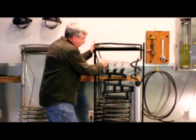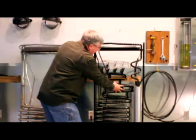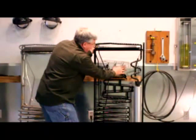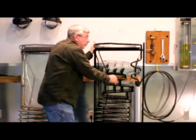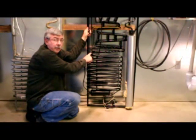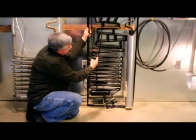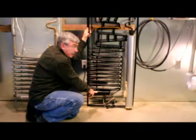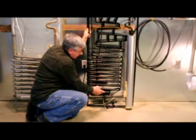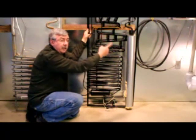The ammonia vapor slowly passes through the evaporator — from the low temp evaporator down to the high temp evaporator, and down to the exit of the evaporator line. This is where the evaporator is attached to the freezer compartment, the refrigerator fans, and where heating and cooling transfer takes place. When the chemical exits the evaporator, the hydrogen is saturated with ammonia vapor, making it heavy — it goes down a tube to the absorber vessel, where liquid and gas are separated. The hydrogen leaves the vessel and goes back up to the top of the unit; the liquid portion eventually ends up back in the boiler, where it's all recycled and starts all over again.